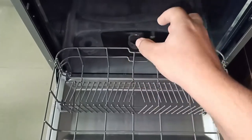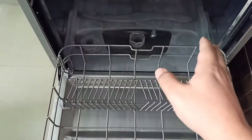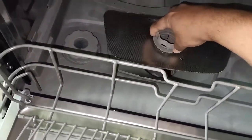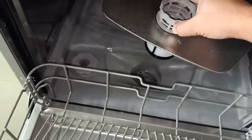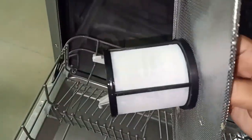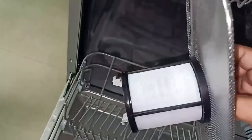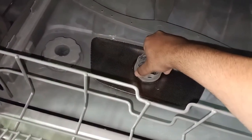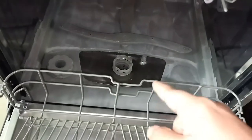Now the filter part. It's very simple — just take it out, take it to the sink, and clean it thoroughly. Spin it anti-clockwise to open it and it comes out in your hand. Clean it deeply if there is any residual, and clean the mesh part with a soft brush and normal detergent. To put it back, run it clockwise. This is for my IFB Torino model — in your dishwasher the mechanism to take it out and put it back might be slightly different.